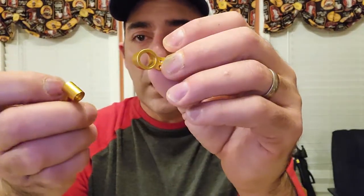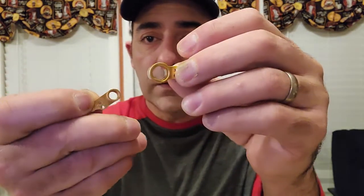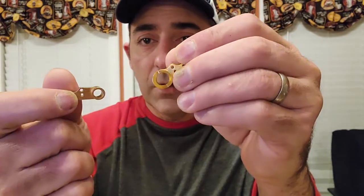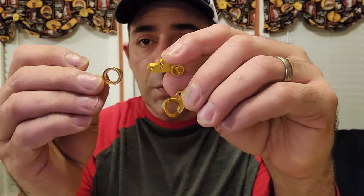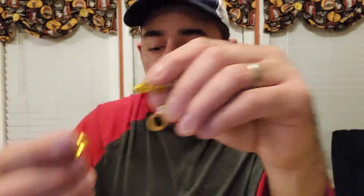There is a mod out there where you fix these parts so they do not allow the wheels to wiggle in and out for the steering, so that you can tighten the steering by the arm that goes on these. Once it is installed, you drill them and you put bearings in them, and then you can, in essence, put the screw in, because it tends to wobble on these little tiny screws. So there's a trick or a hack for that as well.